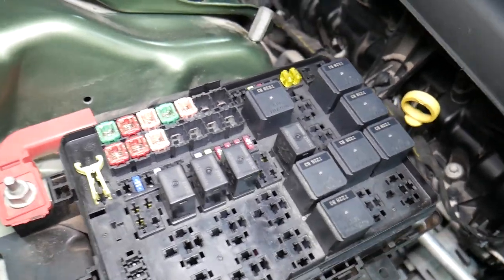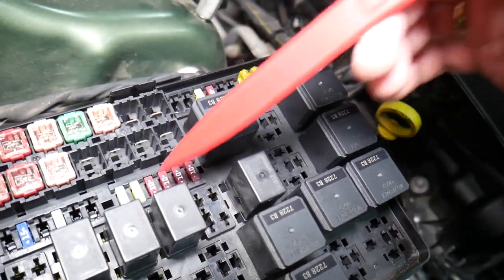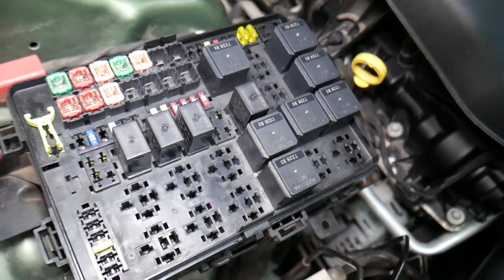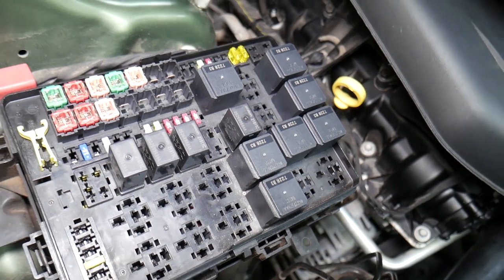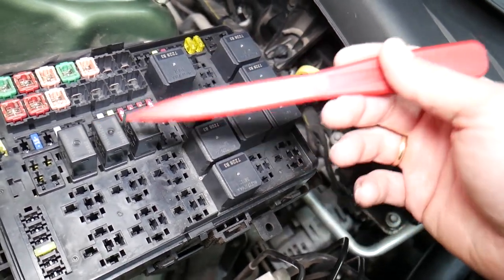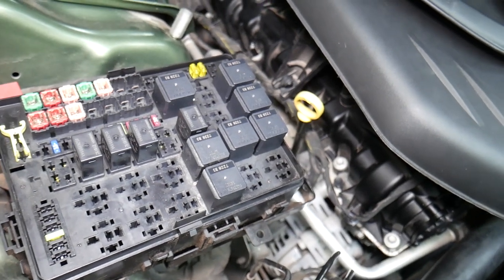Let's explain quickly why it's always a good idea to test fuses and relays. It is super important to always test fuses and relays — this is a common mistake people make. Sometimes you may think a fuse is good, or you cannot clearly see if it is burned. In that case, you may put the fuse back and end up spending money and time on parts you don't need. All you have to do is test the fuse. We'll put a link in the description below on how to test the fuse — it takes only a few seconds to find out if it's good or bad. The same thing applies to relays. We'll also put a link below on how to test relays. For some fuses, it's important to disconnect the car battery when removing them — otherwise you can burn the electronics.